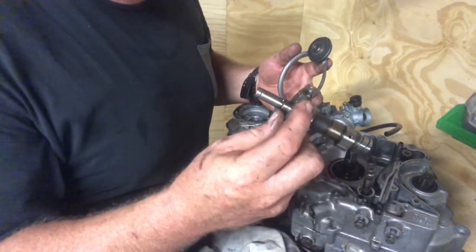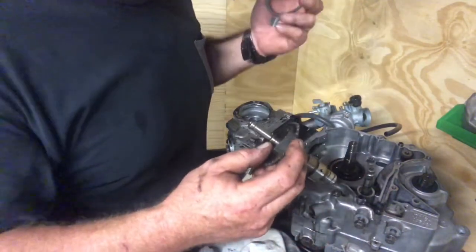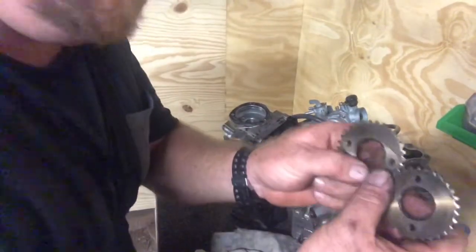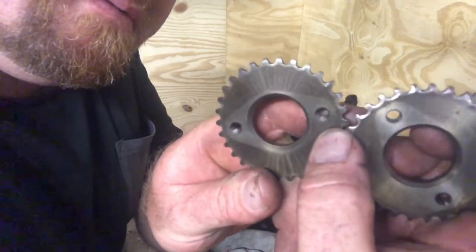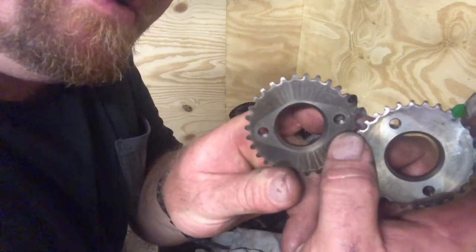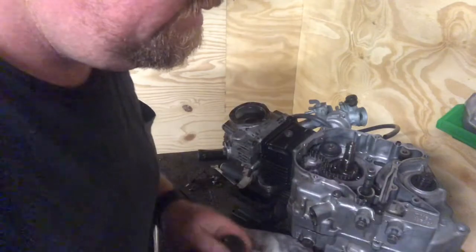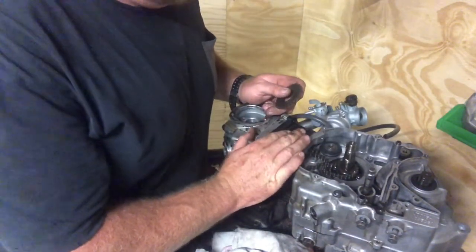We're going to change those out. I found a nice oil driver that has hardly any wear on it. I checked the cam gear because if there was wear on the oil drive there's probably going to be wear up here - it's actually not bad. As I said in the earlier videos when we first pulled this motor, I suspect it's had some work done up top. I've got some more of these so I'll go through and check - if I've got a better one I'll put it on. I just found another one that looks pretty much new. You can see how the one from the engine is shiny and has the shape of the chain worn into it - the teeth have rounded off. They should be square at the top.